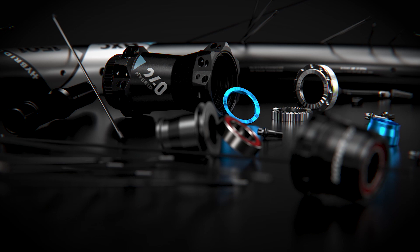That seems challenging — on one hand achieving agility by making wheels lighter, and on the other hand needing durability, since the torque of the motor combined with leg power demands more durable wheels. One important point was the classification of the wheelset. The normal hybrid wheels have the ASTM4 classification, and the light support wheels also carry the ASTM4 classification, but we work here with a reduced maximum system weight of 130 kilograms. The challenging part was finding the perfect combination of all the parts.